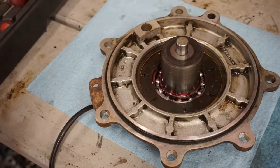All right, we got the new bolt in there on the water pump with the crush washer. It's all fixed up. That bolt must have been partially loose when I drained the coolant the first time and I must not have noticed it when I was rebuilding it. But yeah, good thing that was the only problem. I thought for sure like a line broke or the head gasket blew or something serious, but just a simple fix. And now it's up and running again, working great.